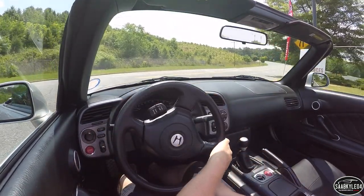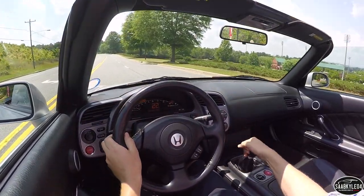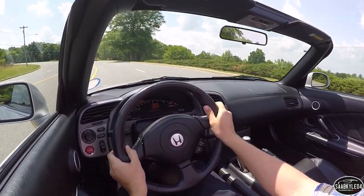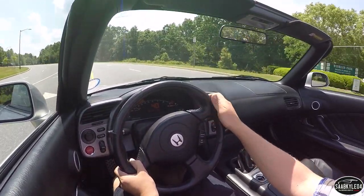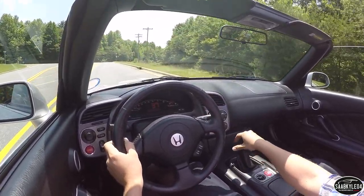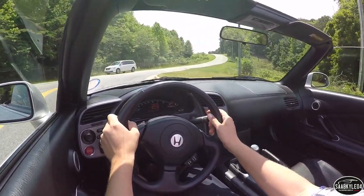Like the 08 Civic Si I tested a while back, VTEC plays a key role in this engine's performance. It does this by using 2 distinct cam profiles, one optimizing the valves for low-speed driving and fuel economy, while the other optimizing for high engine speeds and maximum torque delivery. When the profiles change over around 6,000 RPM, the sound of the engine becomes even more aggressive and raspy, very distinctive. It all happens in the background, all you feel is smooth power delivery.